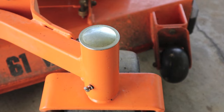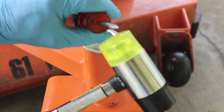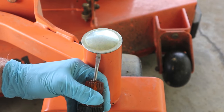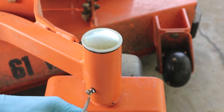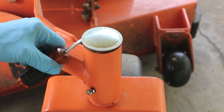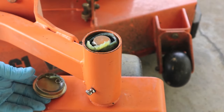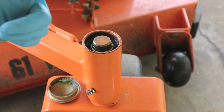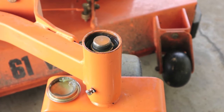I'm going to show you just how to remove that one with the screwdriver. We'll use the hard plastic end of the new $6 hammer. This screwdriver is kind of damaged — you can see it's been pried a lot, so it's got a bend in it. We'll work evenly around it. There's still some old grease in it, but I'm going to go ahead and clean this out. This is what Scag wants you to do every year: clean that out, put in some fresh grease, and get it right up here visible at the top.